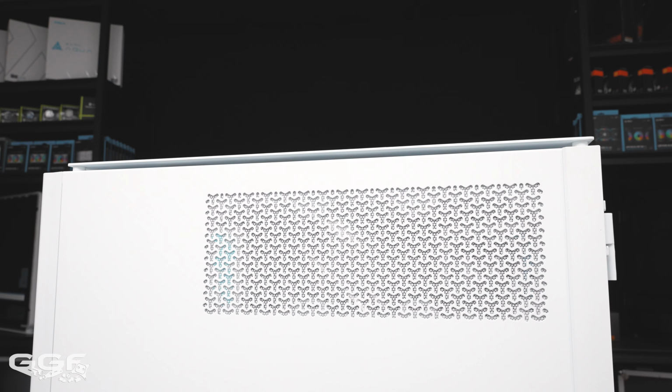This was just enough to fit a Hardware Labs Black Ice 480 GTS with fans at the top on the inside of the rails. I had to use Hardware Labs 480s here because Corsair did not have 480s in slim. If you prefer the fans on the underside of the radiator for a push config, we can flip the front 480s around so the ports are at the bottom. Then flip the top Infini-rail clips over and mount the 480s directly to the rail system, then the fans. For my rads, I did have to remove this little indicator part for the radiators to mount flush.